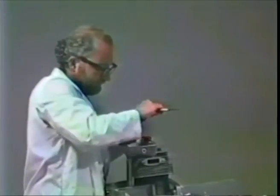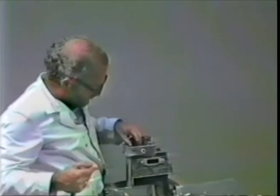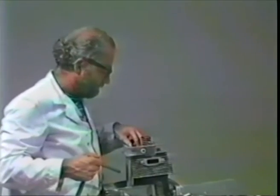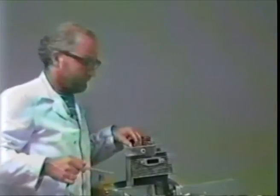So you get these things down to about 10 foot-pounds or so. You make sure that the head bolt seals are sealing, that the head bolt's not sticking out too far or down too far. If it's out too far, it means there's probably another washer hiding down below. If it's in too far, that shouldn't be the situation, unless you left out the head bolt washer.